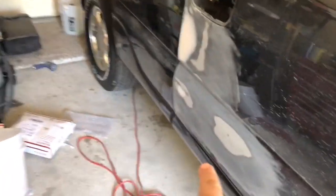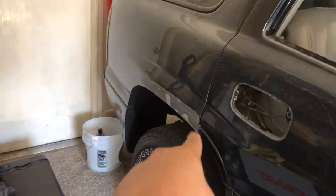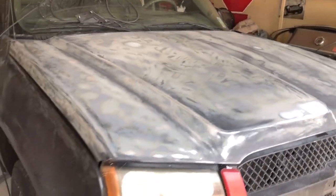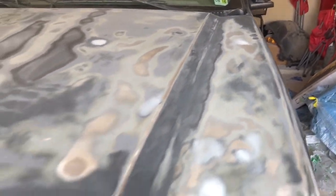There's just a few small dents over here - I just blocked this out, it didn't need body filler but looked a little wavy, so I just blocked it down with 180 grit. The hood was a pain in the ass - I blocked almost the whole thing down to the bare metal. Same thing - a little dent there, a couple small dings here and there, a little bit up here. I think there's one more I gotta get right here.